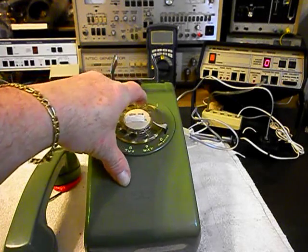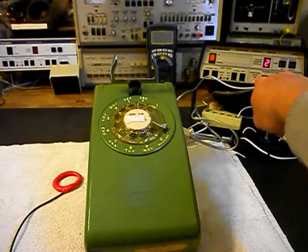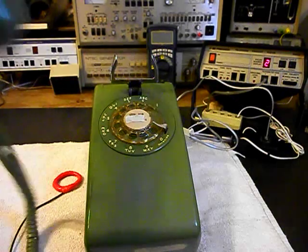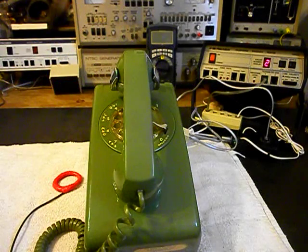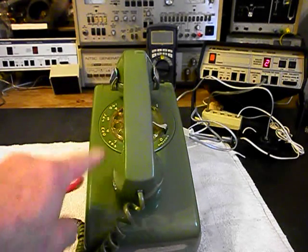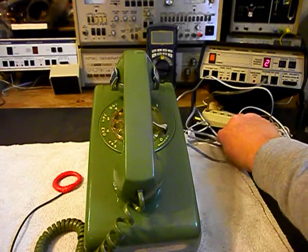I'm going to end in a 2. Now I want to transmit into the handset. If you watch that red light on the analyzer, every time you see that red light light up, that's an indication of 100% modulation on transmit. One, two, three, four, five, six. Hello, hello. Go ahead and hang up. Now since we know that the telephone rings in on a ring cycle, we have transmit, receive, and it's dialing out. We can push this button on the switch box — that gives us a line out and totally takes the analyzer out of the situation, and we can call a time and temp number.